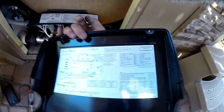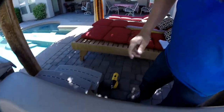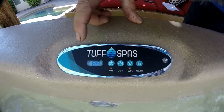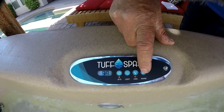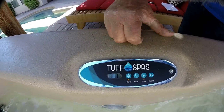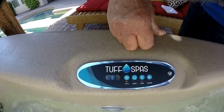The cover just slides on and goes up to it. Any information you need is always on the back of the cover — very important. It appears that we fixed this hot tub. It's not showing the HH error anymore. You can see that the red light is on, so it is heating. Right now the temperature is at 84 degrees and we've set it for 100. We checked the filter setting — hit heat up and then jets and it's in F1, which is where it should be. We're at 100 degrees set and she's ready to rock and roll.